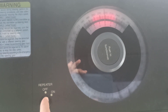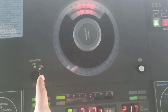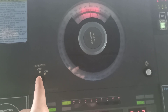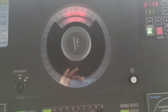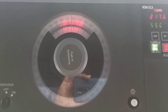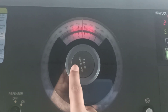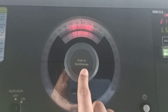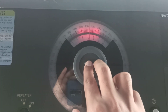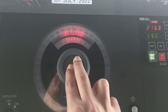To synchronize, first rotate this knob to the off position. Now it is on the off position. As you can see, heading is 217.6. You can synchronize by — as you can see here it is written 'push to synchronize' — you push and rotate the knob clockwise or anti-clockwise as per your heading.